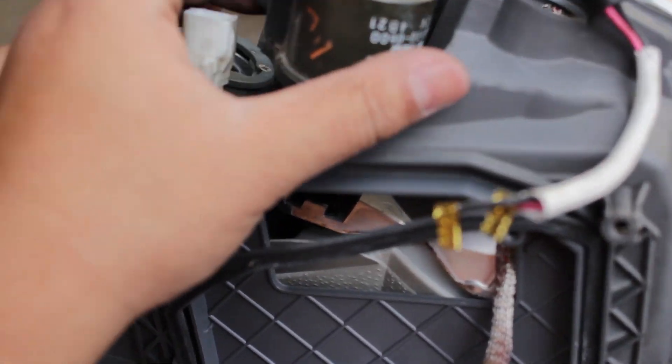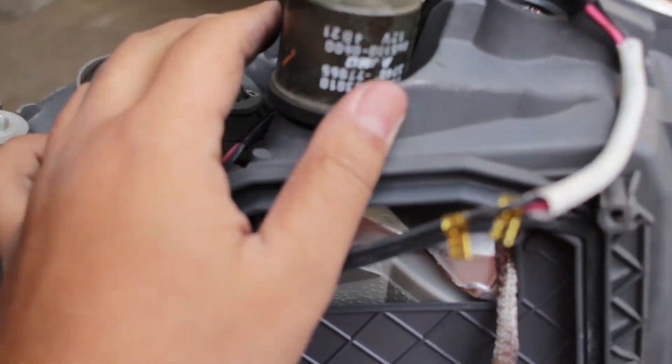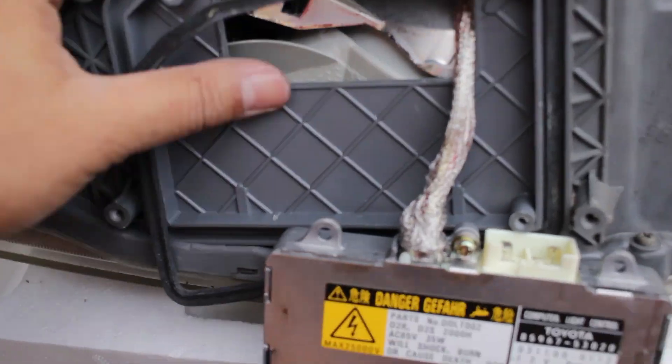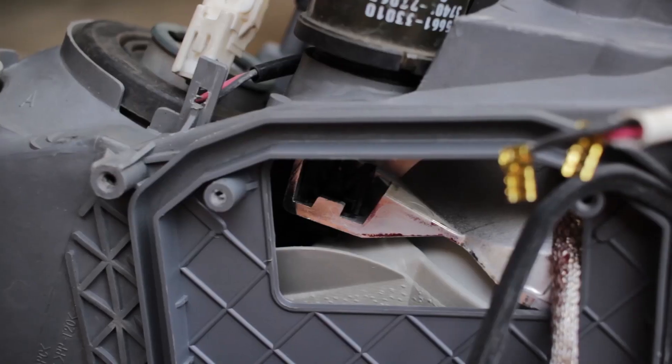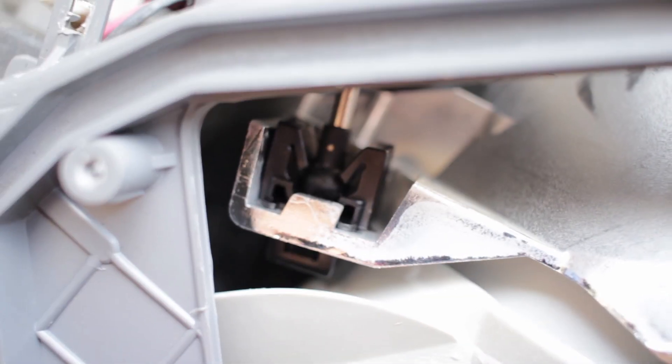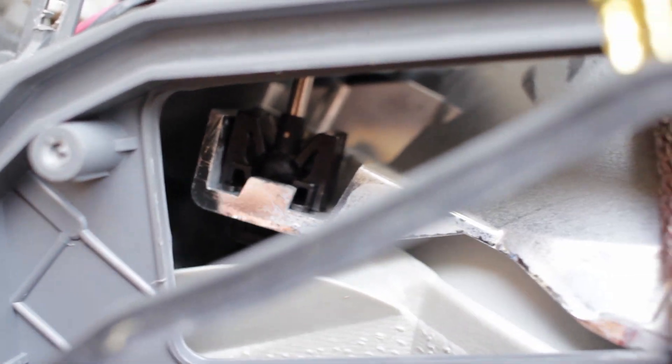I got this loose now. Be careful on how you take this out because I broke mine and had to buy a new one — they charge you a hundred dollars at the dealer, but I found one online for about 20 bucks. To get this off, it's pretty easy. See that little ball joint right there? You get a flathead right where the ball is connected at the end, lift up, and pop. I'll show you — I can't easily show you one-handed but I'll be right back.